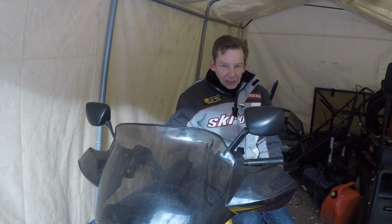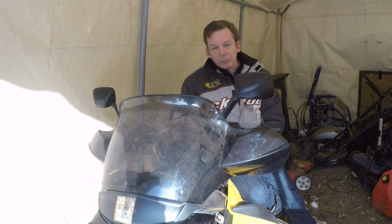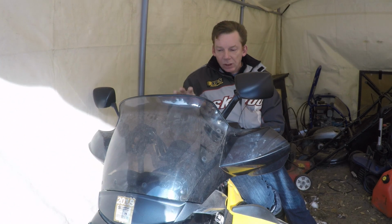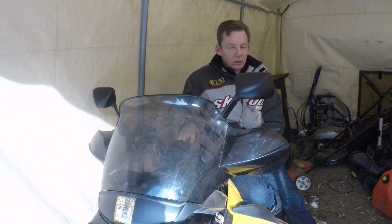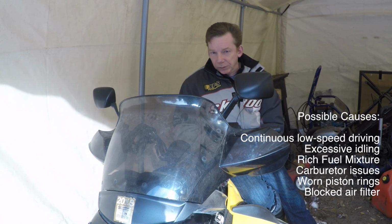But if you let it just sit and idle too many times, it'll foul, and that's happened to me quite a few times. So that's the type of fouling I'm talking about in today's video. If you find that you're not letting the machine sit at idle or run at low RPM and you're still chronically fouling plugs, then yeah, there can be a mechanical issue with the sled as well.